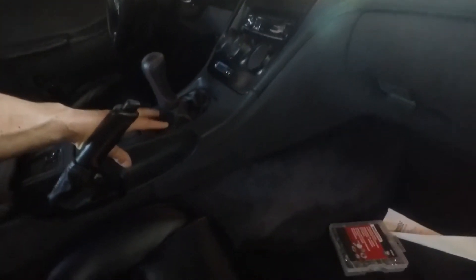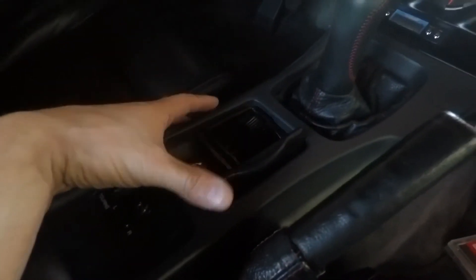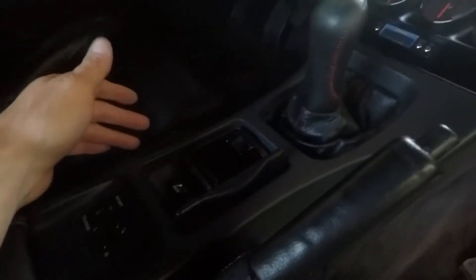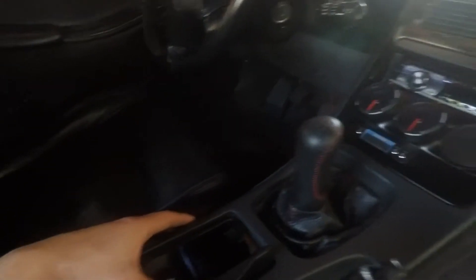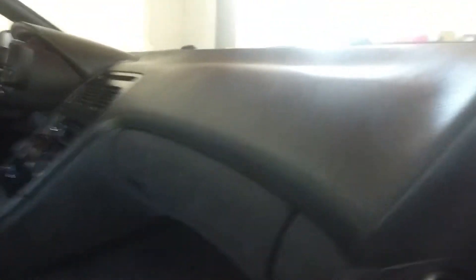The route I'm going to take is up through the center console - underneath the shifter there's a dust boot and I should be able to wire things into the car through there. For power, the cigarette lighter only gets power with the key on, so if the car's not on there's no power running to it. I'm pretty sure I'm going to use that as the power source and simply run the wires up to that third slot in the boost gauge console.